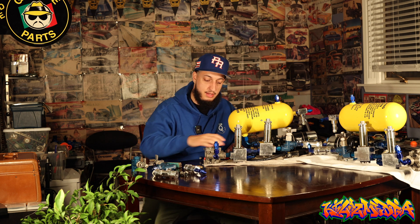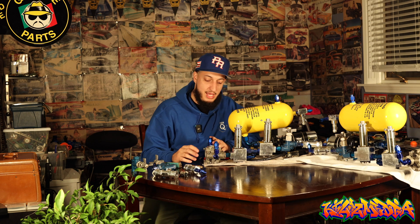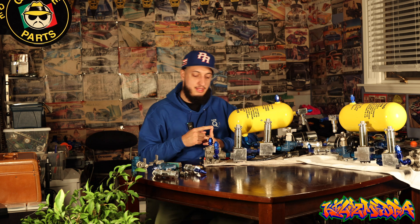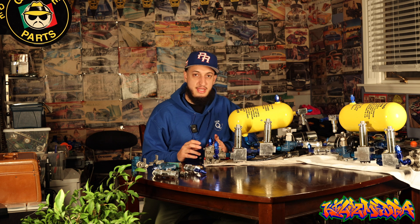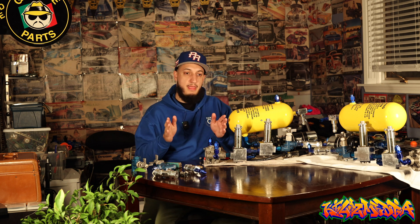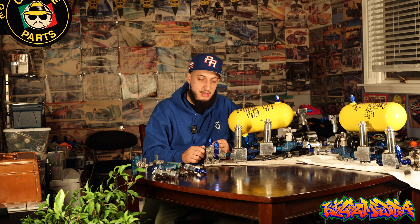Out of the square we get to the Pesco EQ. The EQ is equalizing the flow of fluid — there's a gear inside. There are a couple different equalizers: a Bendix and a no-name one manufactured today. All they do is send the same amount of pressure, which allows you to run just one dump. If you're ever in your car and you run one line to a Y or tee and hit a corner and the car turns sideways, the equalizer prevents that. You usually put it on the rear more than the front.